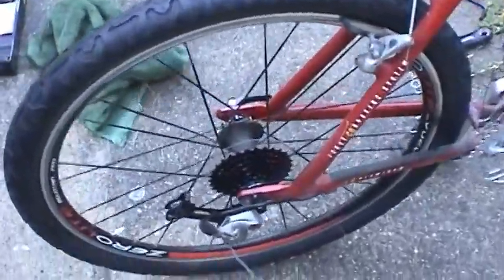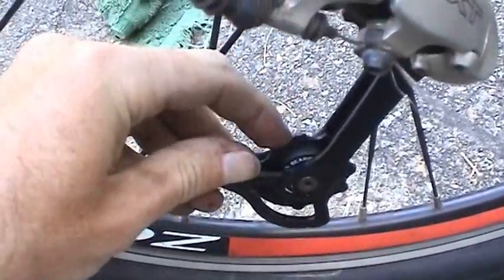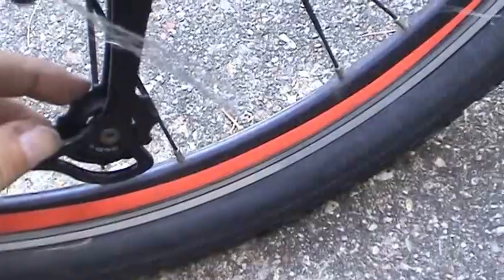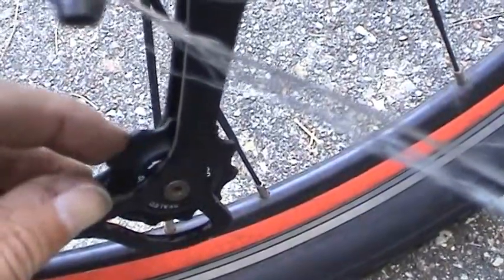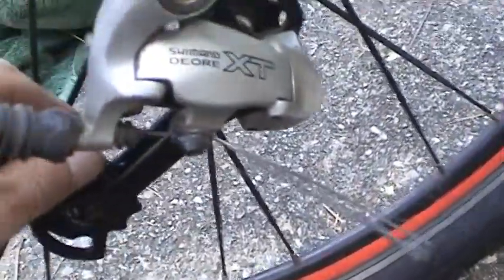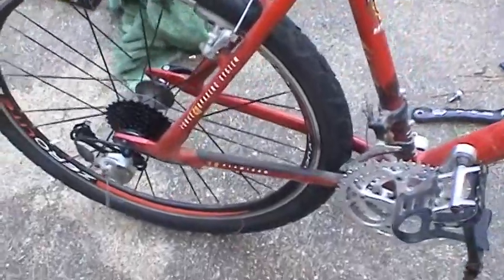Okay, went ahead and got those pulleys installed and got the wheel and tire assembly all mounted up. This thing's starting to look a lot more like a bike now. There aren't any instructions with this pulley kit, so I'm assuming that is the tension pulley, and that right there is the guide pulley, and this guy is directional. So you can see the little arrow right there, and so this guy basically turns in the same direction as the crankshaft. So I know I've got it in the right direction. The only thing I'm not quite clear on is if it's the tension pulley. But anyway, I'm going to go ahead and get that chain mounted on there. And then let me thread that through, and I'll show you how to use that tool to attach the master link together.